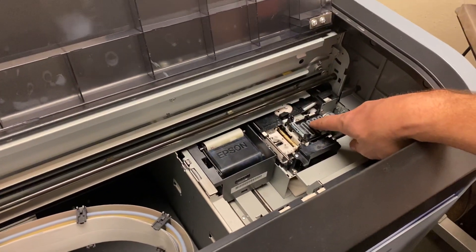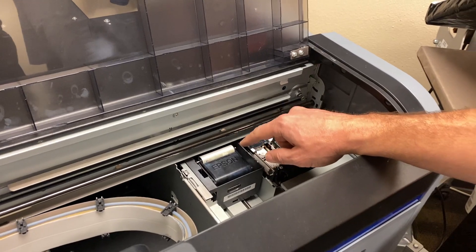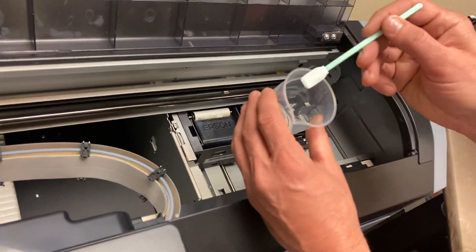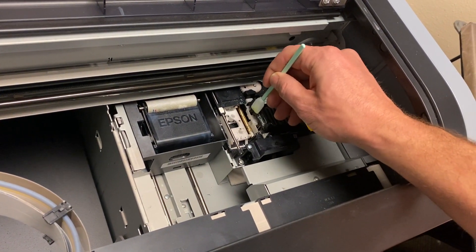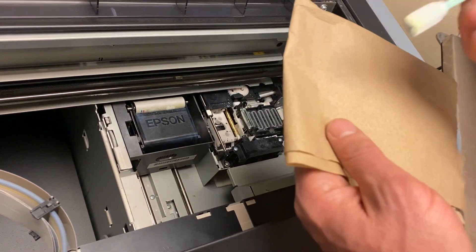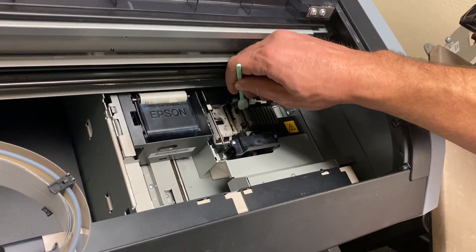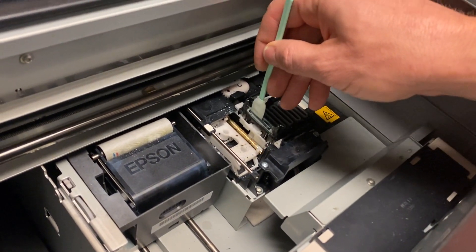What we don't want to clean is this — this is your anti-drying capping station. That and the fabric roller are replaced every 1,000 prints or so, or when the printer reminds you to do that. That's a manual replacement, not an actual manual cleaning. So I use my cleaning solution and my fabric wiper. I want to get in there and start breaking up the ink buildup. I kind of think of it like cleaning an oven — sometimes you just have to put a lot of solution on there to let it start breaking down the buildup.